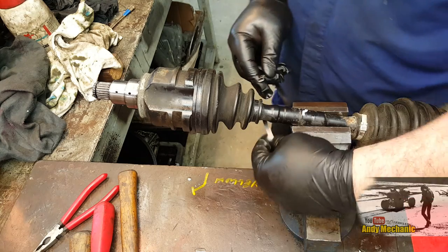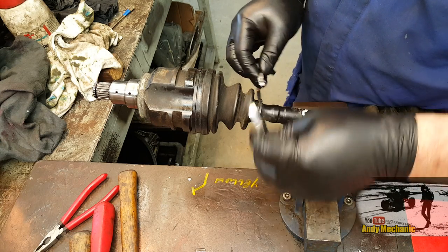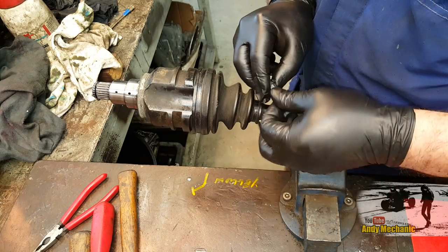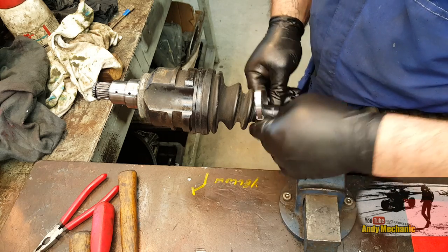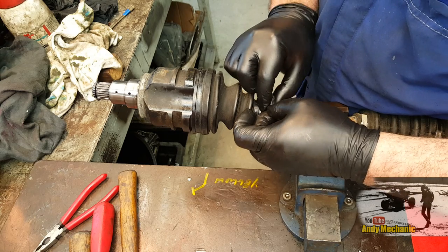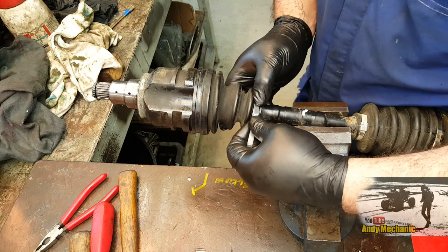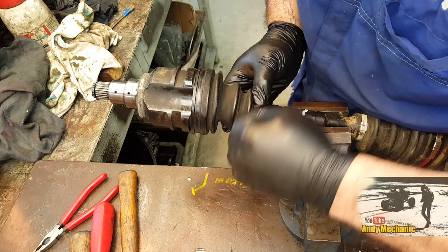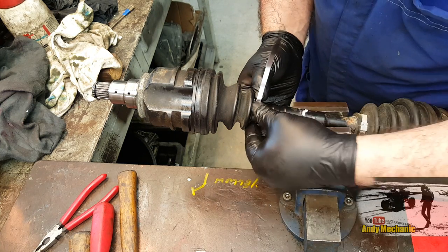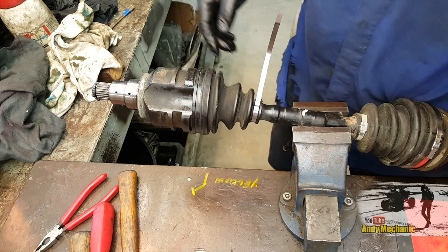Okay. So get your new clip, pull it all the way out, and let's do it the other way around, so it's a bit easier for the camera. We'll thread that through there. We're going to go all the way around and back through again, because that really makes them a lot stronger. And it actually helps when you tension them up. Okay, so now make sure you're in the groove and just pull it tight by hand. There you go. And then bend it back by about 120 degrees, I suppose. That way it's not going to slip back through and it's going to hold its tension.